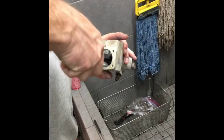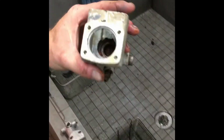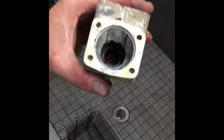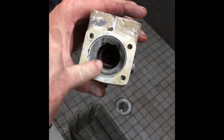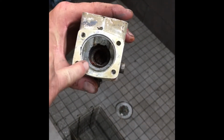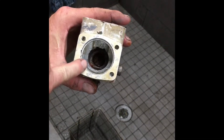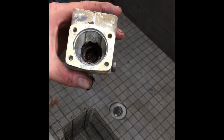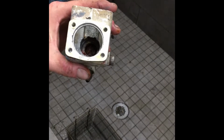Just gonna stick it back in. Okay. Right, so now we've got the wheel cylinder here. So our next challenge is, at the bottom of this, there is a piston cup down there that actually is what makes the hydraulics change into mechanical energy to operate those levers we talked about earlier.